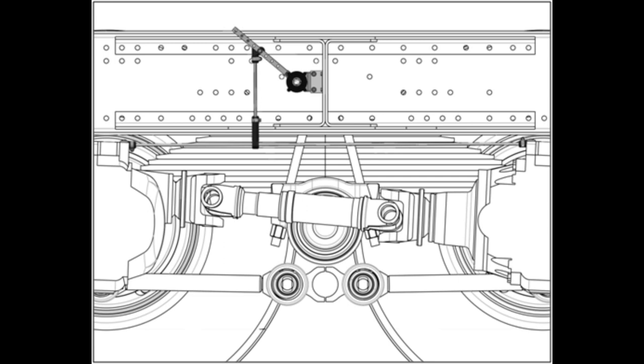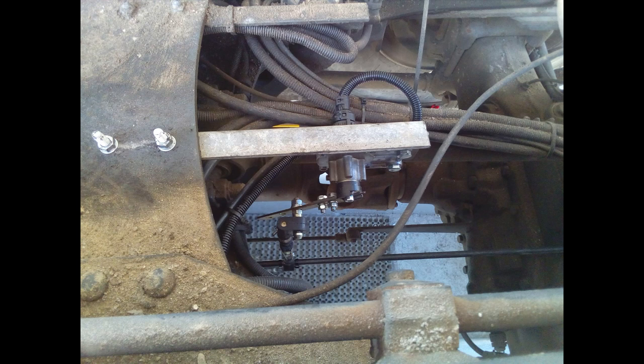Also, when mounting the sensor to the front axle, you can weld a corner directly onto the axle, with a hole made in the corner to which the lower end of the rod is attached. In case the spring works on two axles at the same time, an additional rod should be used. In the middle, it will be connected with a vertical measuring rod, so we measure the average vertical displacement of the two axles.